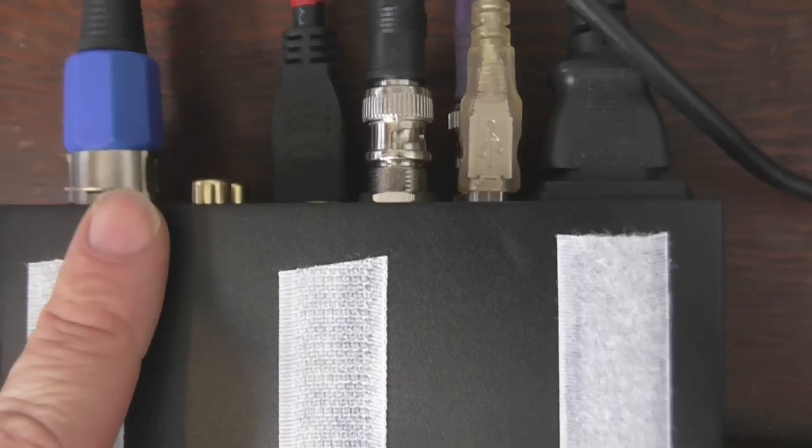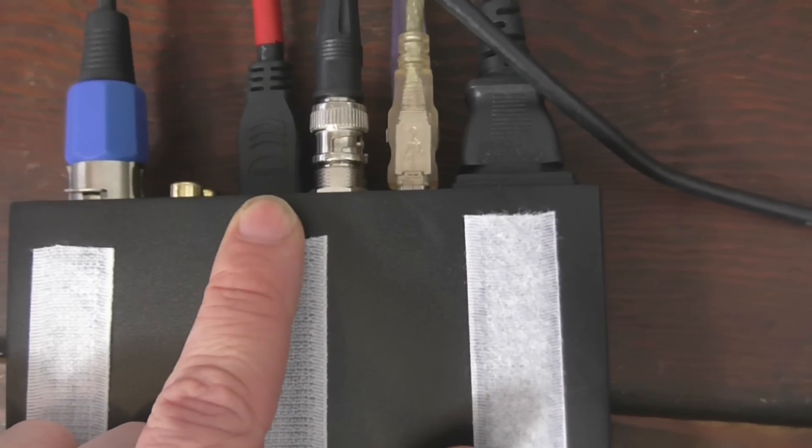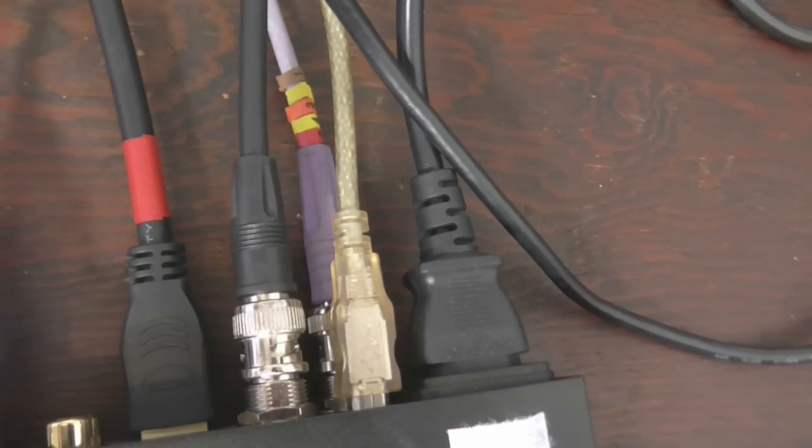The way the Web Presenter works is it will combine all of the different audio feeds. As mentioned: the G3, audio coming in from the Blackmagic Pocket Cinema Camera — I've disabled that audio for the purposes of this — and the purple cable camera we are currently using. All of the audio feeds just get merged together. It is worth saying that with the G3 inputs I actually had to turn the output gain up to plus 12 for it to even register. I would like to see a little bit more control — maybe even other functions on the Teranex Smart Panel unlocked, such as the volume control, or the round knob on the front becoming a volume control, with the audio button being switched on.